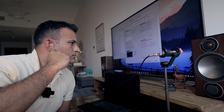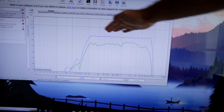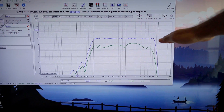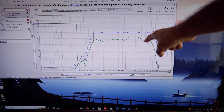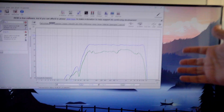We're going to make two measurements - one with it in ambient sound mode and one with it in noise cancelling mode, to make sure the noise cancelling is actually working and bringing something down. You can see the green line is below the blue line. The blue line is our reference point - that's without any Bluetooth earbud, that is the reference signal. There's a little bit of passive isolation from the earbud itself, but that's pretty much the transparency mode.